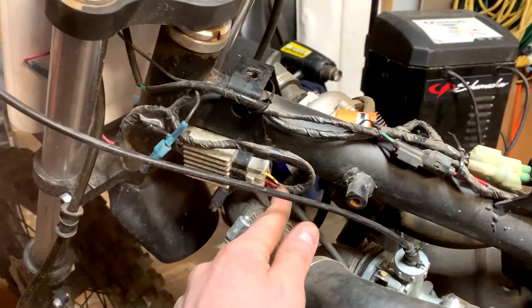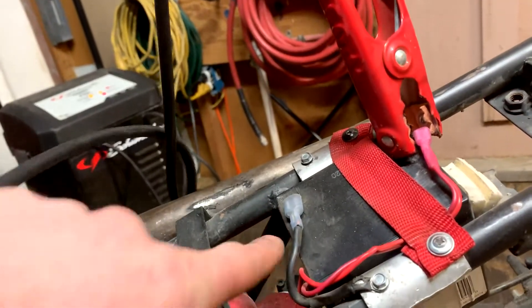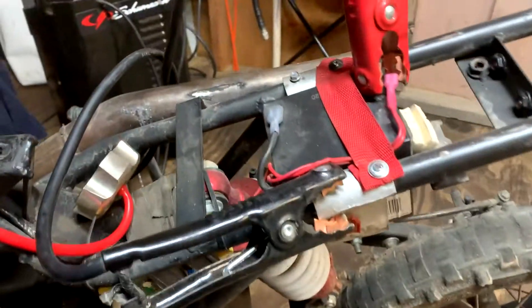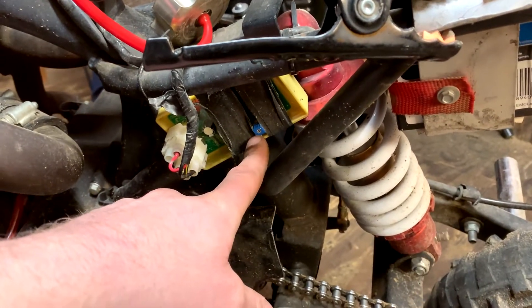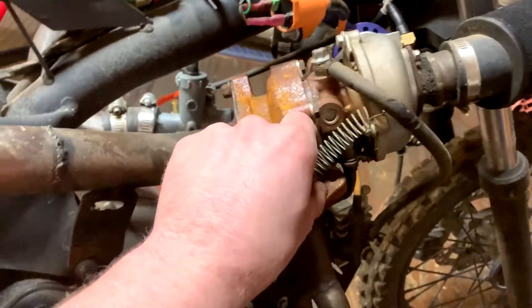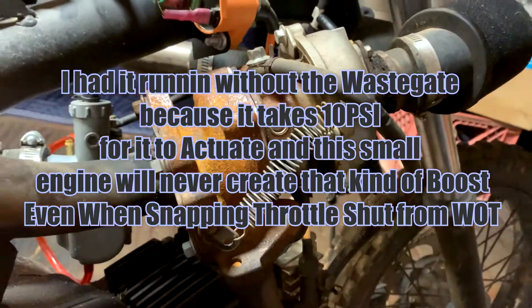The yellow and white wire goes from the stator up to the regulator, then the red wire goes over to the battery, and the black wire just goes to ground. I have the DC-fired CDI because it's easier to start - it's got a hotter spark and you can adjust the timing curve. I have it adjusted to retard the timing at higher RPM. The turbo on here is a VZ21. I had the wastegate just closed with a spring - I'm not sure how effective that is, so I'm thinking I'll put the wastegate back on and plumb everything in correctly.